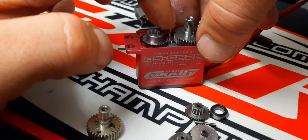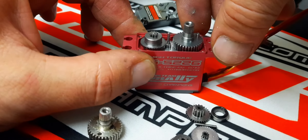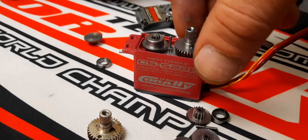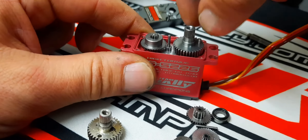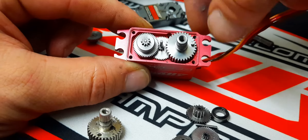Finally the last gear — I'm going to wait with that one. It's going to go between here and lock the servo motor together with the potentiometer. These are the tools you need to trim things or whatever. You should do this because sometimes when your servo gets a good hit — like your wheel — and your servo saver is too hard, look at these gears and then you complain the servo broke.